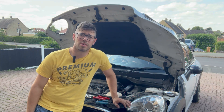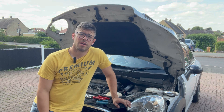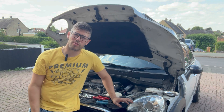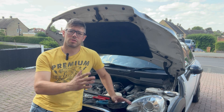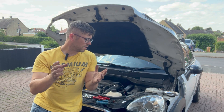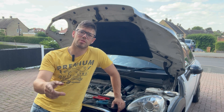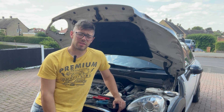We're done — the car now sits at a steady 86-90 degrees on idle. I'll take it for a spin to check for leaks, but at the moment nothing's coming out. It did do a big burp and chuck a load of coolant everywhere when the thermostat opened, which was annoying, but other than that we're good. Not a job I fancy doing again. My advice: I bought the TVT one because it came with the different loom. If you can buy the loom separately and know which one you're buying, go for an expensive name-brand one because you really don't want to be doing this twice.